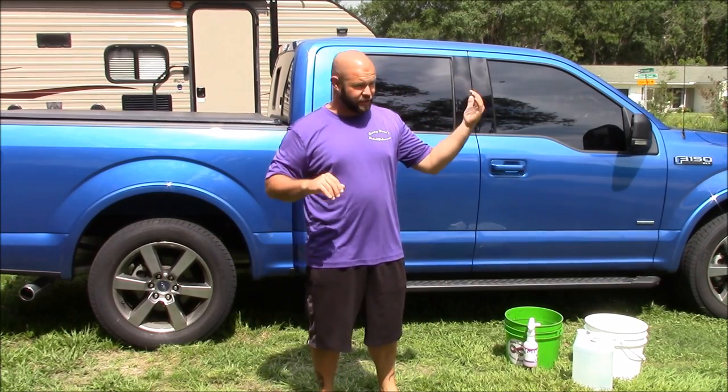There's a lot of people on the internet talking about things they don't know about, but what I do know is that in 2012, five years ago, I released the Gary Dean Wash Method. The biggest benefit over a traditional rinseless wash is that you're not reintroducing old dirt that came off the car back into the wash bucket at all. With the pre-soak, which encapsulates the dirt and lifts it off the surface, there's less chance of inducing marring into the paint and creating swirl marks.